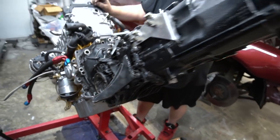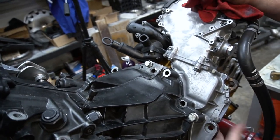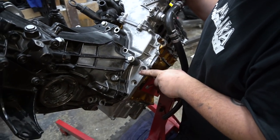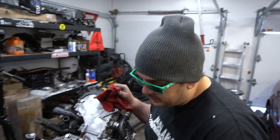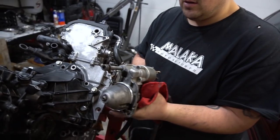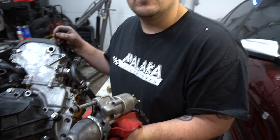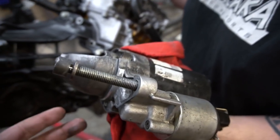We're going to put the last few tidbits on the motor, and then we're going to put the starter on since it's easier while it's fully accessible. What kind of starter are we using? A VR5 starter. What other starters would work? The 034 Motorsports starter, which George used to use. What factory starter will also work? The Phaeton starter will also bolt right up. The part number isn't visible here, but we can provide it in the comments.